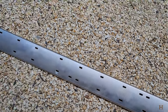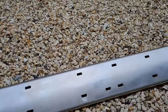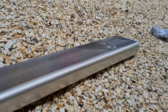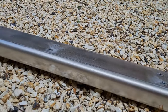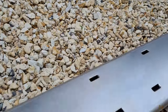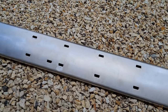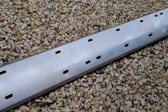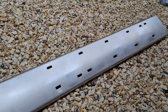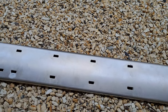All right, we got that done. I sanded it on all four sides — all the shininess is gone, the underside as well, the front, all the edges. Just really take your time on this step; this is probably the most important step. The prep is critical in order for the bed liner to stick. Next up is wiping everything down — I'm going to use some acetone to get everything nice and clean, all the grease off from my hands.